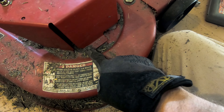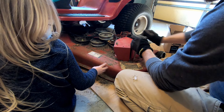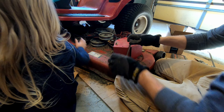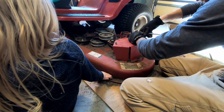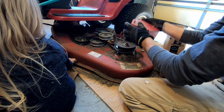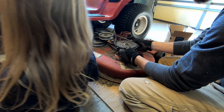To route it around this pulley, this pulley, and this pulley — this pulley is obscured by a big protective box. To get to the box, we're gonna take off this bolt, this bolt, and this bolt. This is a 10 millimeter. There's a lot of grass in here. Taking out these nuts and bolts so we can get to the pulley easier. It has these two bolts — these are actually just guides to keep the belt on.